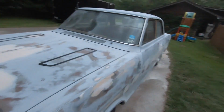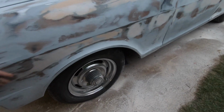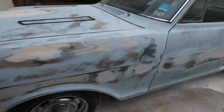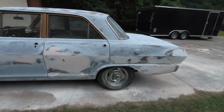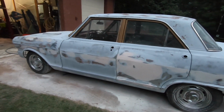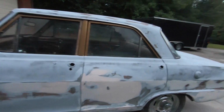All right, we are done with the rough end, what I call roughed in body work, which is basically all of the body work that had major dents in it, large areas we had to get some Bondo and filler in, have been addressed and smoothed out and ready for the next priming. So we started from square one. We started from basically taking this thing down to original paint and or bare metal. We etch primed and then re-primed, and then we went to our heavy body work, or our roughed in section of body work, which is all these big dents.